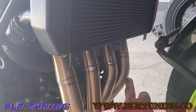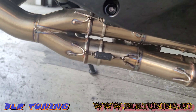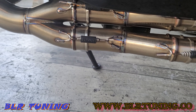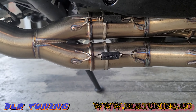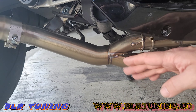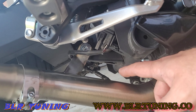That'll put your spring up in the opposite corner. The pipes are numbered: cylinders one and two are joined together on the top collector, which ends with stamp 06; cylinders three and four are joined on the bottom collector, which ends with stamp 08. The curve on the pipe is coming out towards the right-hand side of the bike towards the back. Here the curve should be going up and towards the back, with your bracket up towards the top. It was a little bit of a chore to get the bracket and bolt to line up. Also remember, your O2 sensor is on the back side — a little different from the norm. We were able to run it up and over the bracket, and after our shakedown run last night, the O2 sensor looks fine.